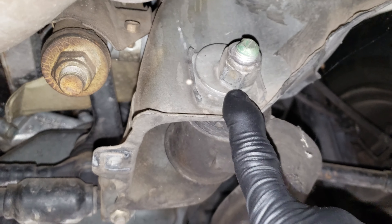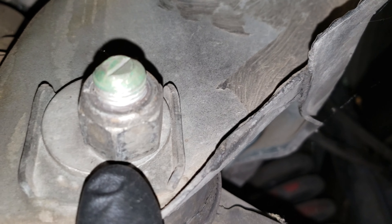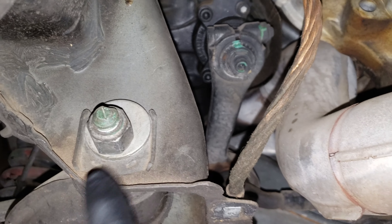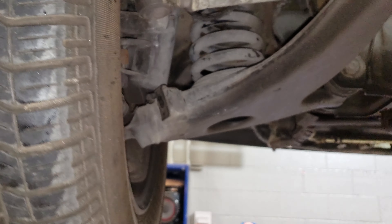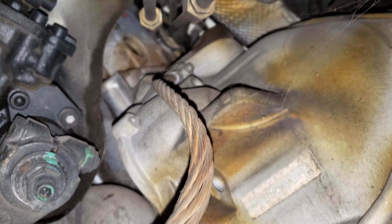These don't look like they've ever been changed — the alignment bolts don't look like they've ever been moved. There's no ghost rings around the eccentric washer on either side. There's a little sticky stuff that might be from the road. These tires are from 2007, so when I replace the tires and wheels I'm gonna have to roast these things and do some pretty crazy burnouts with them. Everything up there is dry.